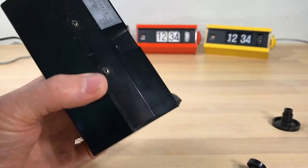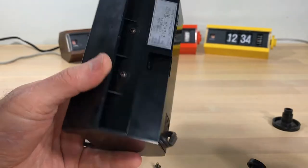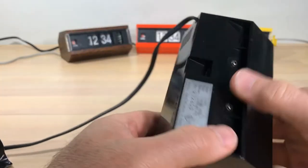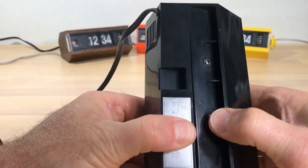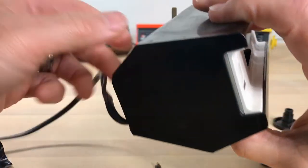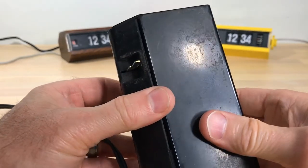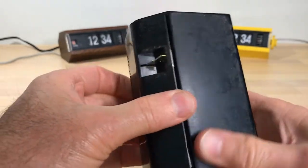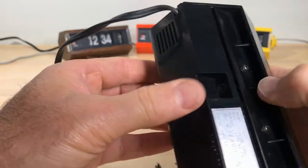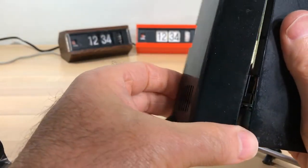To get it apart, you just take this one screw off here, which allows you to get the cover off. To remove the cover, put a little pressure with the thumb — I'm pushing down and then pulling away. On the other side you do the same; there are tabs that you're releasing. Just work it out — there's no rush, you shouldn't have to force anything. Once you get it to this stage, use the wire notch and it comes right off.